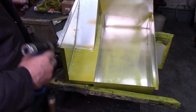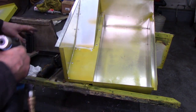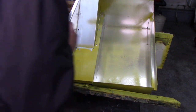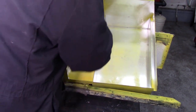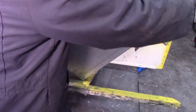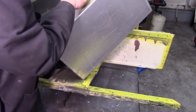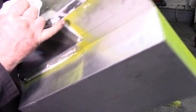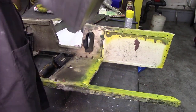That is the seat. Now we can put this seat box together, off the panel, if you see what I mean. It doesn't really matter with this one because we've got the sides off as well. So we're just going to smear our caulking around there, make a nice joint. That's nice. Flip it over, and you can see down there it's not too bad. Might just go around these seams once again, but you can see the caulking's come out all through the pop rivets, so that's good.